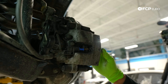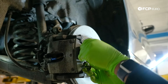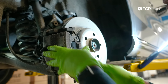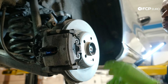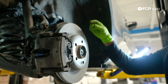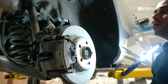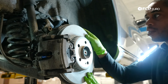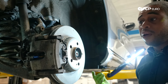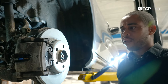The last thing I'm going to do at the front of the caliper is put that tension spring back on — just inserting it and sliding it in. Doesn't require a lot of force. So that's in. We've got the brake rotor on, and you have two visual wear indicators here. When these go away, you know that the disc is spent and needs to be replaced — it means it's at its minimum thickness. As long as these are still visible and the pads are worn, just throw pads at it. Normally on your second pad change you're going to need to replace the disc.